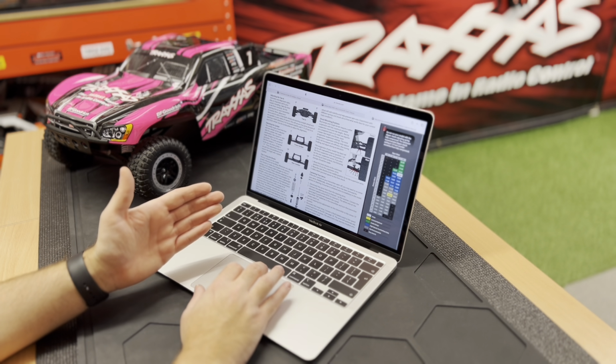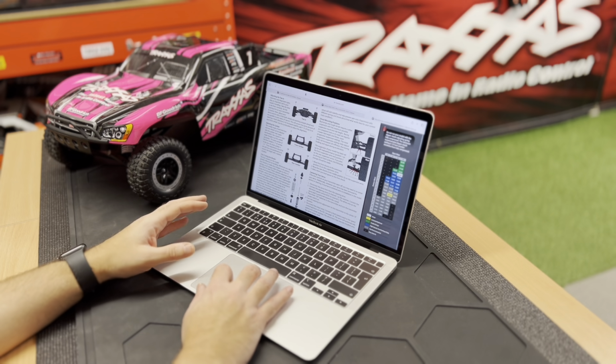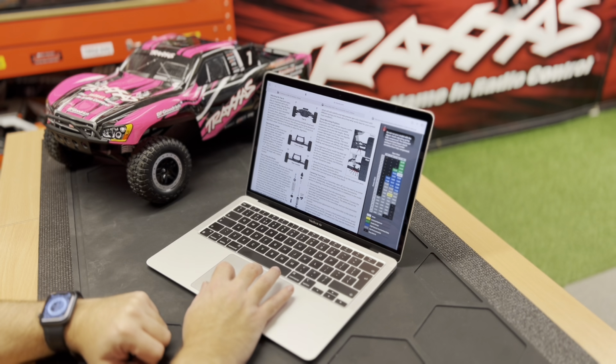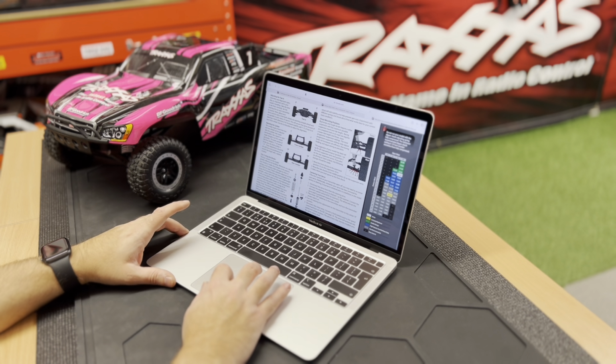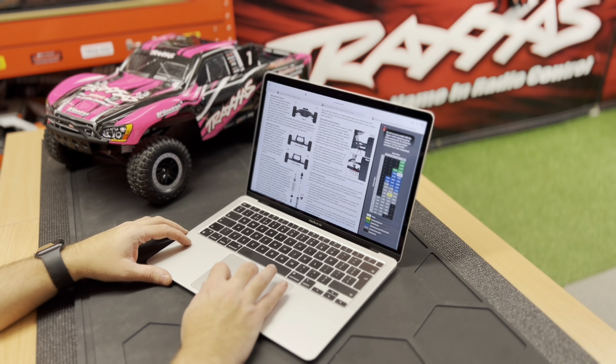For example, shock mounting positions. Big bumps and rough terrain require a softer suspension with the maximum possible suspension travel and ride height. Racing on a prepared track or on-road use requires a lower ride height and firmer, more progressive suspension settings. The more progressive suspension settings help reduce body roll, increase roll stiffness, dive during braking, and anti-squat during acceleration. The suspension of your model has been set up for off-road performance. Position 1 on the front suspension arms and position 2 on the rear suspension arms. If you plan on driving on hard surfaces, the following changes should be made.